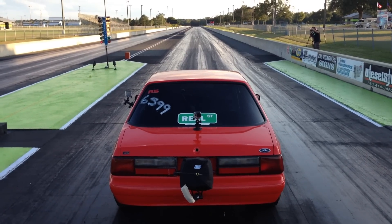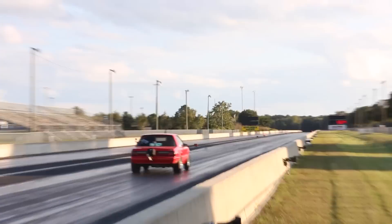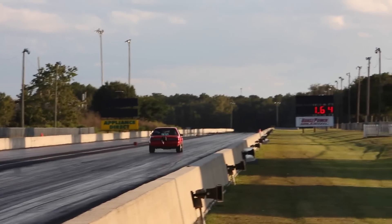What's equally important as the quick shift is being able to carry the power into the next gear. If you're using a turbocharged car, having a timing retard on the gear change will keep the turbocharger online so that if you leave one gear with 20 pounds of boost, you go into the next gear with 20 pounds of boost, instead of having a lag or delay with the turbocharger having to come back up to target boost.